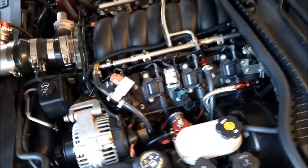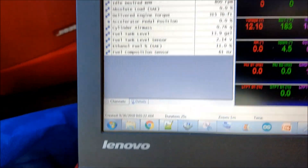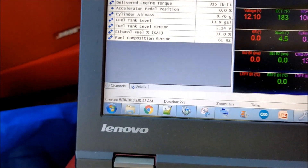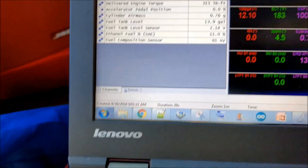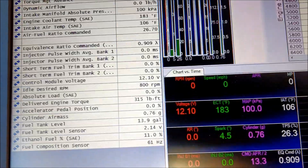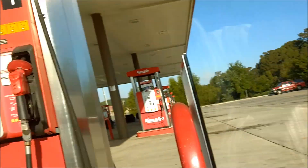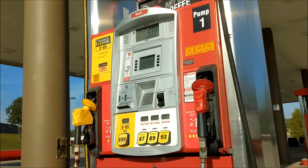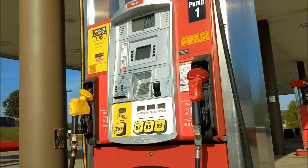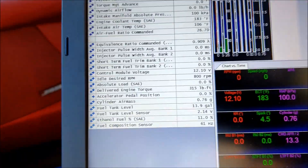The sensor is working flawlessly. I've gone down to the gas station — I'm at about 14 gallons of gas and I want to see if this sensor is working, so I put in one gallon of E85. The pump says 70% ethanol, so they're selling it as E85 but it's actually 70%. I just want to see what my ethanol content sensor is going to do.